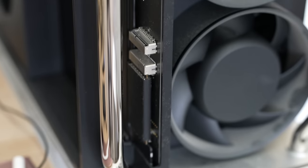Flipping it over, unscrewing the fans — and pop, off it comes. Look at all that space for air in there. All these screws holding one antenna cable just so it can plug in on the other side — I'm glad I didn't try to remove that earlier. These fins — I thought the screws might be holding it to the motherboard but no. The thing that holds down the M1 Ultra chip goes all the way through the motherboard and connects to the cooler on the other side. I would not recommend doing this.